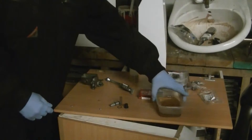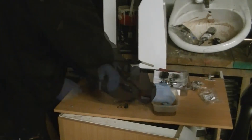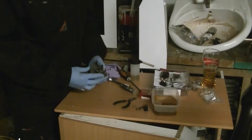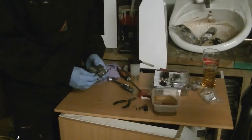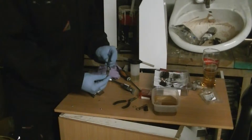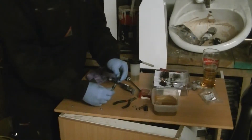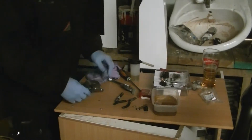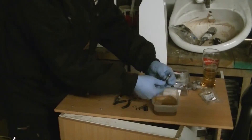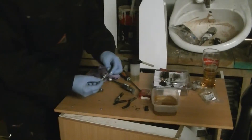The first thing we need to do is get some brake fluid and soak the piston in the brake fluid for around about 10 minutes. This is our master cylinder and I've given it a good clean inside and out so it's looking like new. Remember last time I told you to take the piston and everything out of the master cylinder carefully, because you need to put everything back in exactly the same way. It's pretty easy — it's just a piston, a spring, and a circlip. First thing we do is get our new piston out of the brake fluid after it's been soaking for about 10 minutes, and then attach our spring.